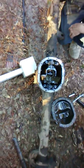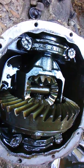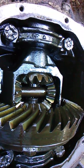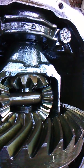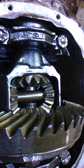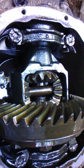This is the inside of that '87 Ford Ranger axle. This is what your gears look like after one point three million-odd miles. See how far that's turning back and forth without the other side spinning. Those spider gear teeth were skipping over each other and getting jammed up — that's why one side was stopping.